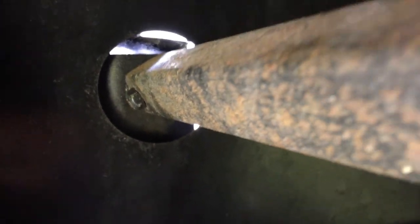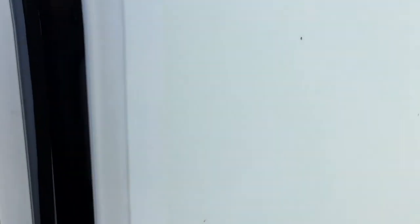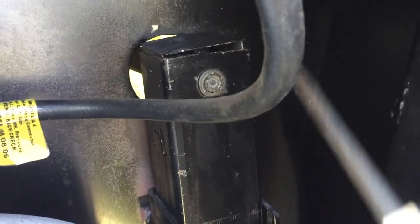Next is getting to the gears on top of each leg. What you need is a flathead screwdriver — there's a cap, and you can see I'm putting the screwdriver underneath the lip and it pops the cap up. My leg is on the gas side of my cargo hold, so the lip is accessible through the center cargo hold. I'm going to spin around here so you can see that cap, and we'll finish popping it up and get it off.